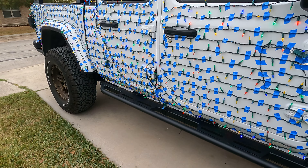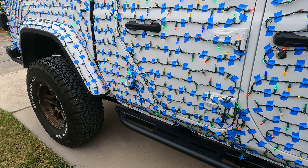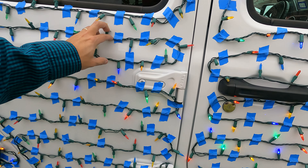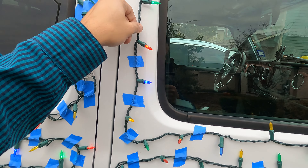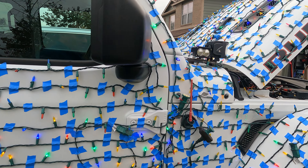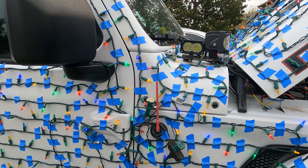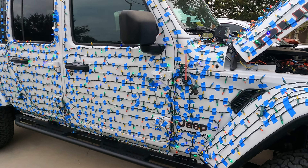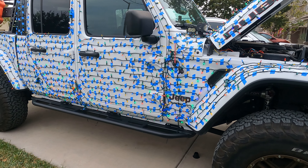As you can see, all these lights — I have them taped off pretty excessively. You may think so, but I do it on purpose because if you don't put tape almost in between every light, it's going to make a flapping noise at a faster frequency when you're on the highway. If you're not familiar with that noise and you're not thinking about the lights, you're probably thinking something's going on with the Jeep itself. I've already driven on the highway at 75 to 80 miles an hour and this thing drives like the lights aren't even there.